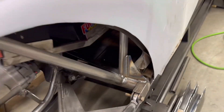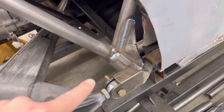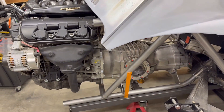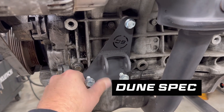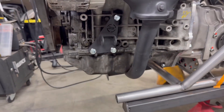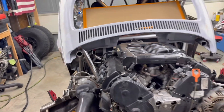Also off camera, I did cut and install these 3/16 plates — these are big gussets to help support this joint at the corner. That in combination with this tube running out to the main chassis means this thing should be very robust. I also got some engine mounts from DuneSpec — these things are awesome, they bolted right in, and all I have to do is run the tube down and I'll have a removable engine mount. Stay tuned for more. Thanks for joining and I'll catch you guys later.